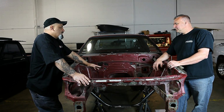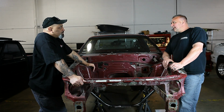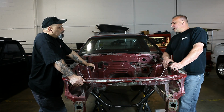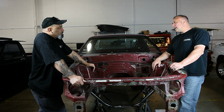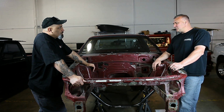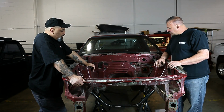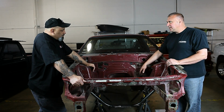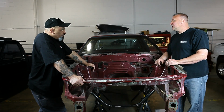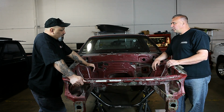So comparatively speaking, on the pay scale, where are you guys at? The middle about? We're in the middle, yeah, definitely. There's K-members out there that are a lot more expensive than ours, and there's some that are cheaper, but you get what you pay for. And time after time, like I said, you will get a fit like that. Nothing has to be ground, nothing has to be hammered on, unless you have some crazy turbo system like that. But it's just a matter of bolting it in, putting your steering on, bolting your spindles up, and like I said, you'll have to pull the sleeve that's in the steering column out another 3/4 of an inch to an inch for everything to line up and bolt up.